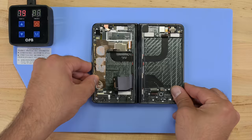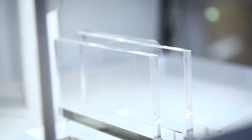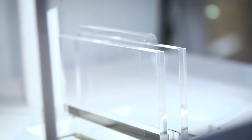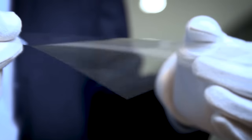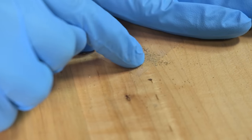The last major component on this device is the flexible inner OLED panel — and it's also the priciest. Flexible panels have a protective layer of ultra-thin glass that allows them to bend at these extreme radii, but there's a catch: the glass is very delicate and even the slightest scratch can create a failure point. To prevent this, a plastic protective layer is applied to the glass, which unfortunately is susceptible to some unsightly scratches.